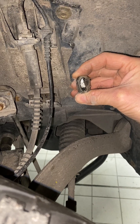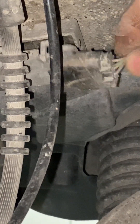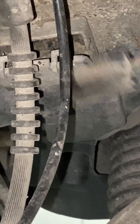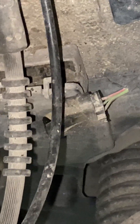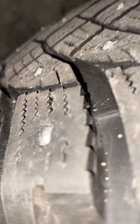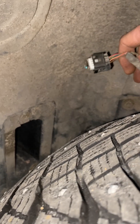You've probably got water in there. The danger of doing this is that the FlexRay — the green and pink wire — has no terminating resistor, so the whole circuit needs to be balanced. If there's no resistor you're going to have no comms. Luckily last week I got some resistors. I put a 100 ohm resistor there — that one's not so critical, but this one is the most important.